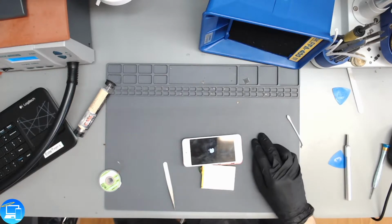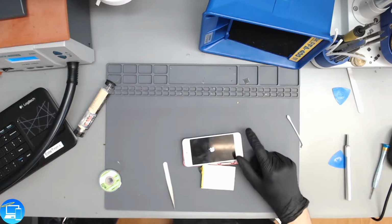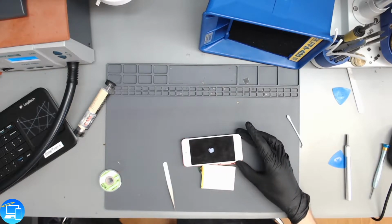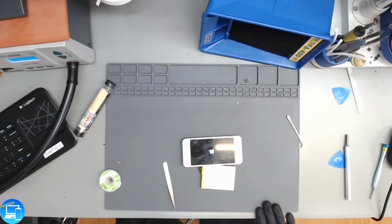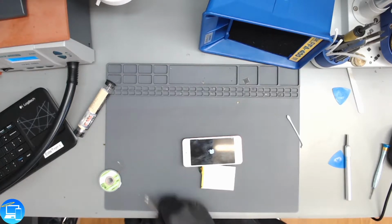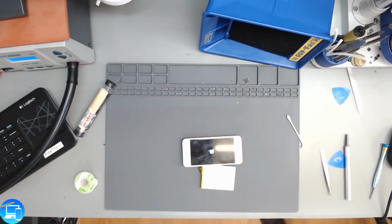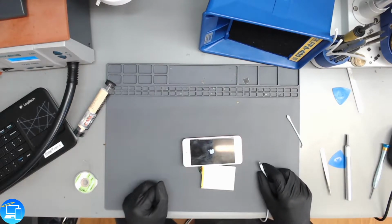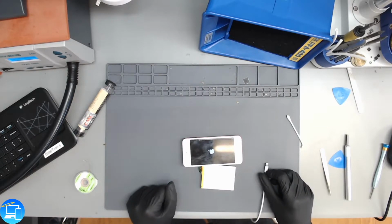And we're going to have one or two things. Either the repair is fixed because it needs a battery, and then we'll finish installing it, or this is going to power on, but it's still not going to charge because we have an underlying charge port or logic board issue. This battery should have enough charge to turn on all the way. In fact, let's go ahead and grab a charger. See if it boots up all the way first. Then we'll plug our charger in.